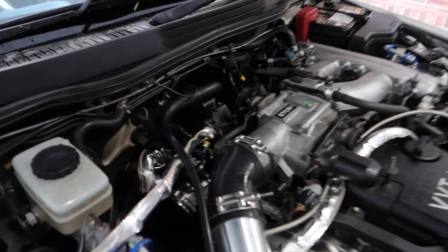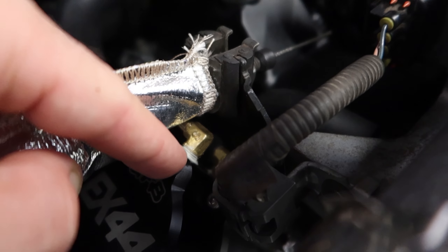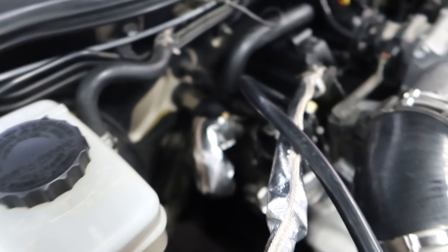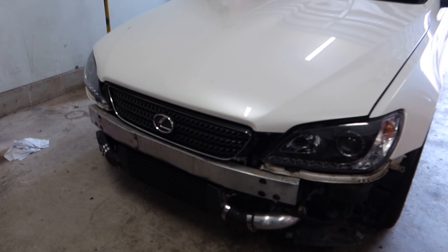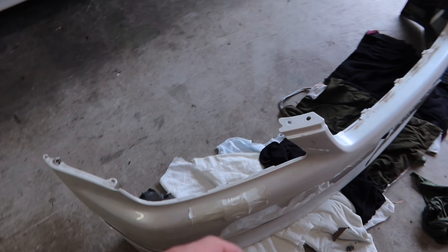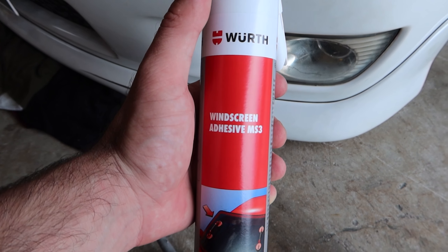The fittings coming off the wastegate were initially straight fittings, but the throttle cable was going to be in the way. So we went to the local parts store and got 90-degree fittings and fit them both up there as well. Everything else is looking very factory — nice tidy plug made up and hidden down there too. That's pretty much everything done underneath the engine bay for now. We've got the standard IS 300 grill on there too, looking like a bit of a sleeper. Just need to seal up the covers for the headlight sprayers — we've got the tape on there and we're going to seal them up on the inside with windscreen adhesive — some heavy-duty stuff.